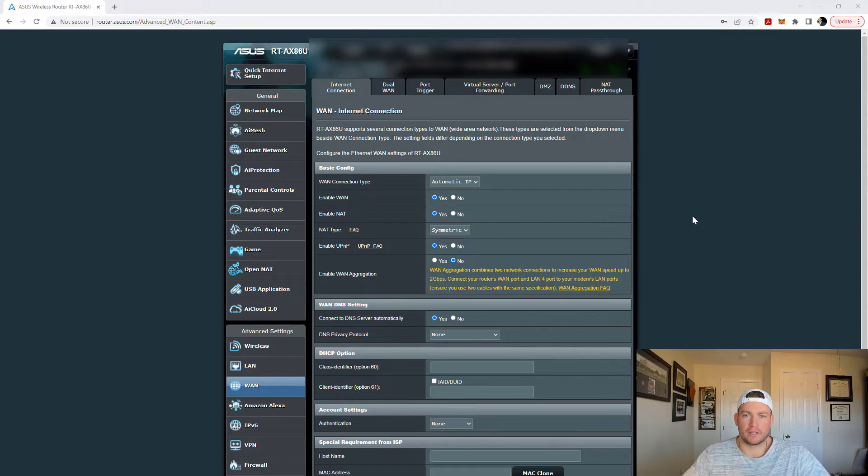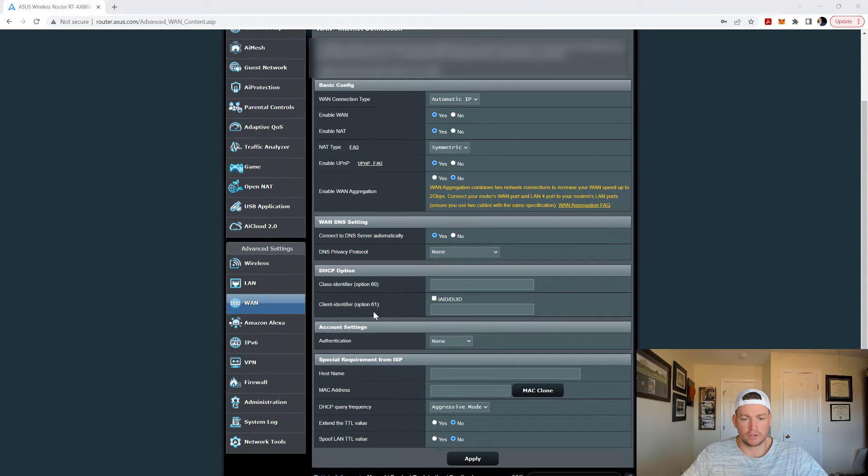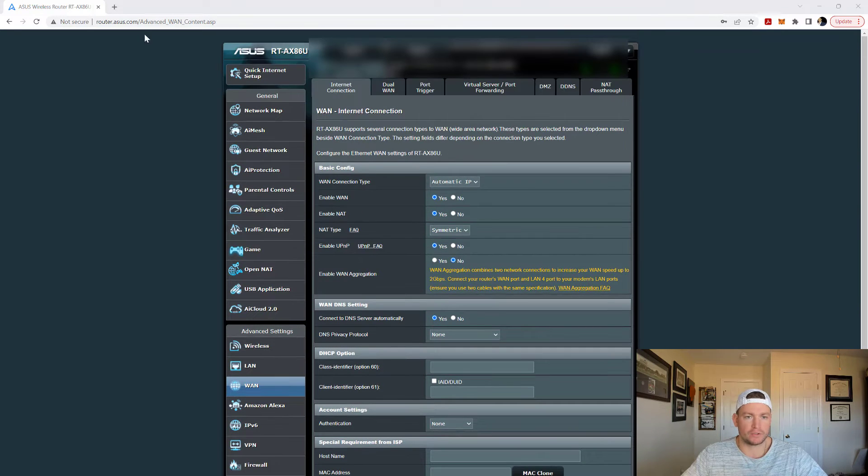The last thing you're going to want to check is that you can turn on UPnP — Universal Plug and Play — through your router. I looked it up and most routers actually come with this already on, but it's good to know how to get into your router's UI and change any settings. I have an ASUS router, and if you go to the WAN section under Advanced, you can see that Enable UPnP is turned on as Yes — that's what we want.